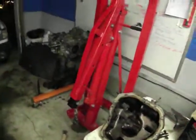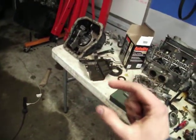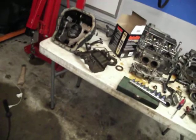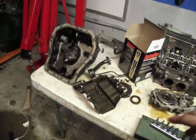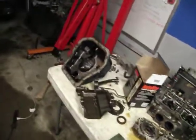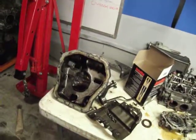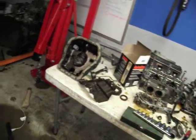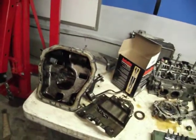Although it's important to add that when I got the car from you, the oil was a full inch above the full mark on the oil dipstick tube. And not pointing any fingers, but there's a lot of stories online of people that have brought their car to the shop and the shop makes some kind of error, you know, doesn't put oil in and runs the car for a little bit, or puts the oil in the transmission, or some stupid mistake like that. I'm not saying that happened to your car, because obviously there's no engine oil in your transmission here, but your car was overfilled by a lot, and I think that is a little suspect. I don't know how someone could put an extra 2 or 3 quarts into an engine like this.